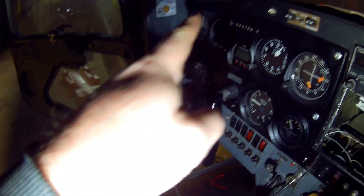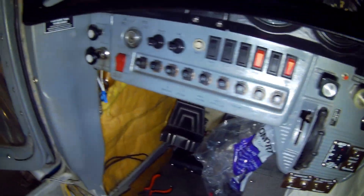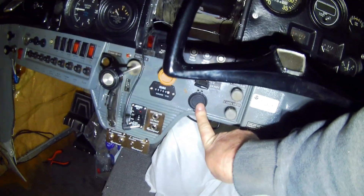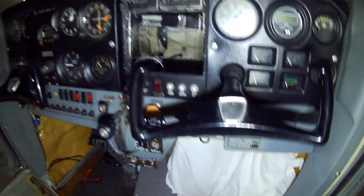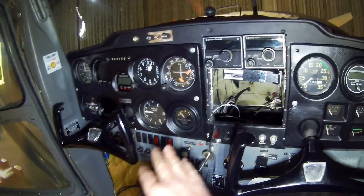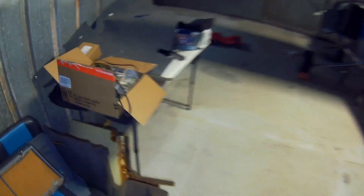We're about 70 hours in now. The tail beacon is wired in, came up all the way through the floor, and is wired into the AV30s with all the shielding and bonding done. I've got my circuit breakers installed with just some touch-up painting needed. The radio is moved up, glide slope is moved up, my new USB outlet is in, and the Hobbs is relocated. The last thing really is the intercom panel. I've got the antenna out for the old transponder.